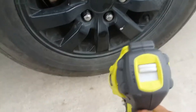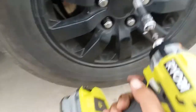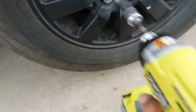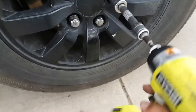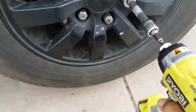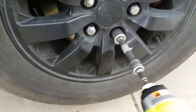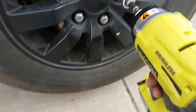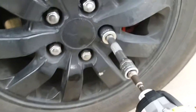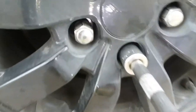And we'll set the rear in first. Go ahead and pick it up and put it in place. All right, and we're actually gonna turn the settings down to 1. That way we don't mess anything up. Let's do a cross pattern already. There it is, the rim set in place. Alright, let's throw it on to 3. See how much more it turns. And we'll come back and we'll torque them down.